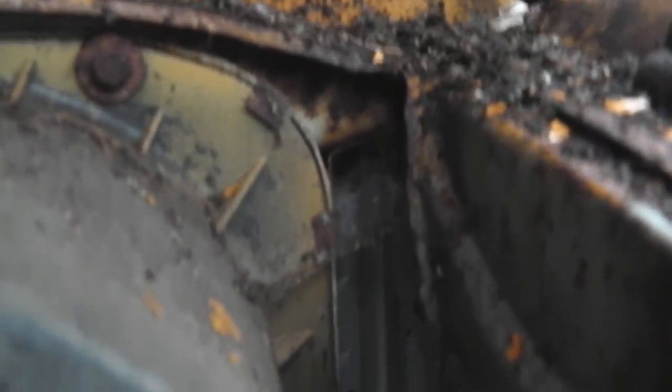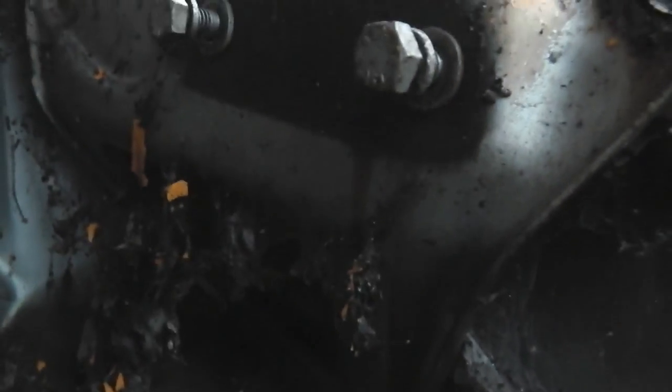Right, so your inner wings. They've gone at the usual bits at the front, but the inner wing and bulkhead behind there, and I've had the heater out, there's no hole and there's nothing there behind that, where they normally go in that corner. Looking through the scuttle too, I can't see anything. I've been looking and prying and poking, can't see anything. Even the hinge mount brackets that normally just disappear aren't even touched, look.